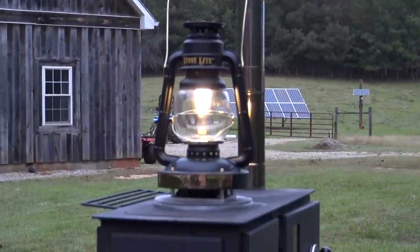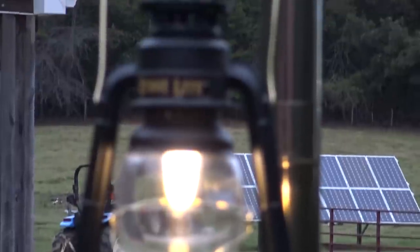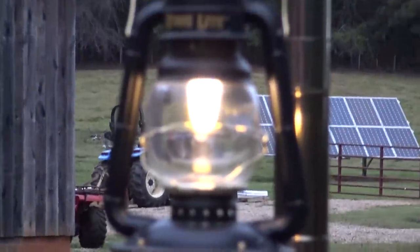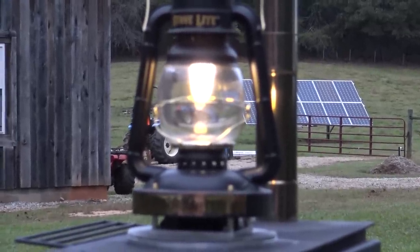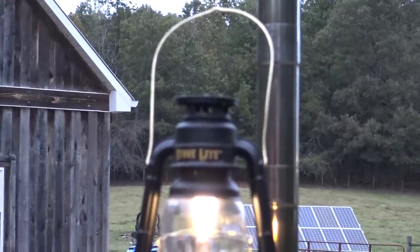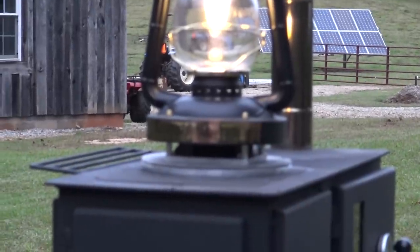Let's focus on the light. At the base there's a thermoelectric generator module with a fan producing electricity, and on the top is a lithium-ion battery. I'll show you the different modes. You can use it not only as a light source but also to charge devices — anything you can plug in with micro USB — charge your iPhones, tablets. You can also use a wall adapter or a solar charger to charge the battery. I was watching the stove temperature; I did get this stove to 815°F, which would be a little extreme for the light — the maximum temperature is 660°F.